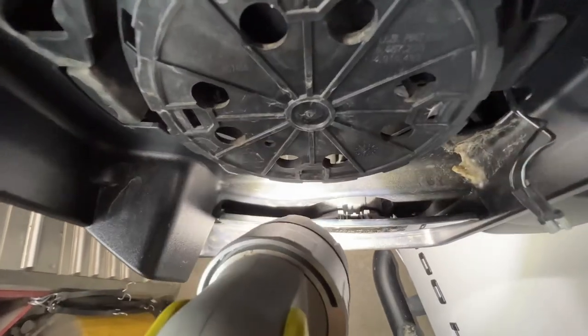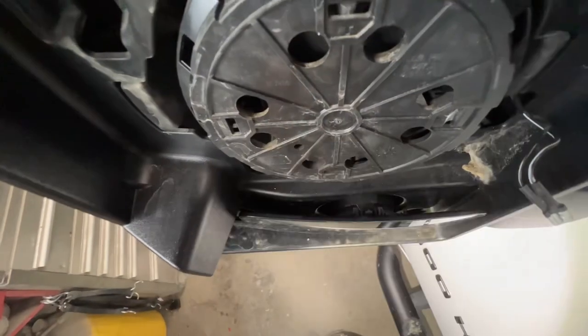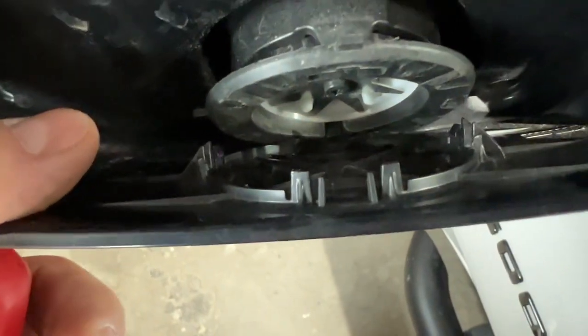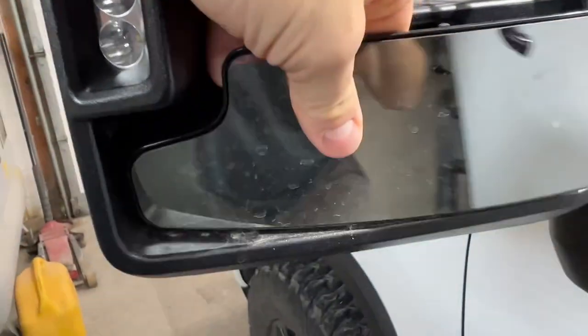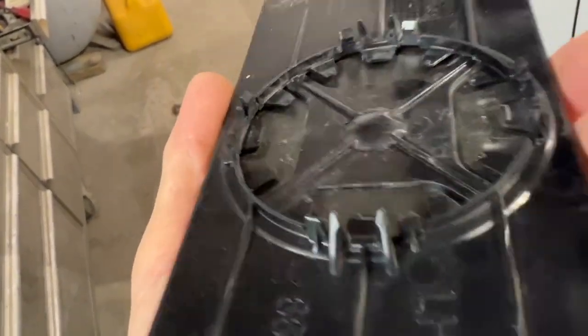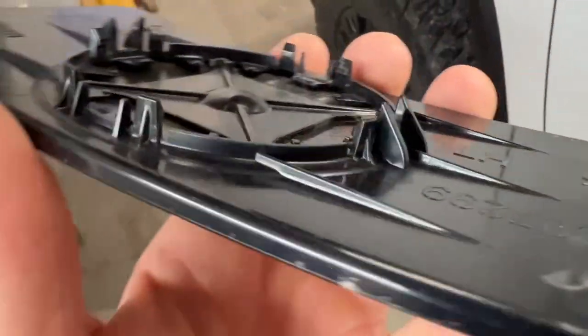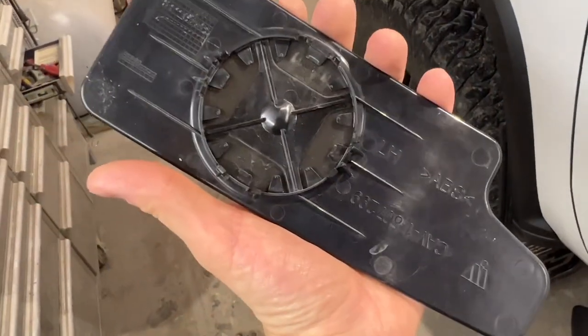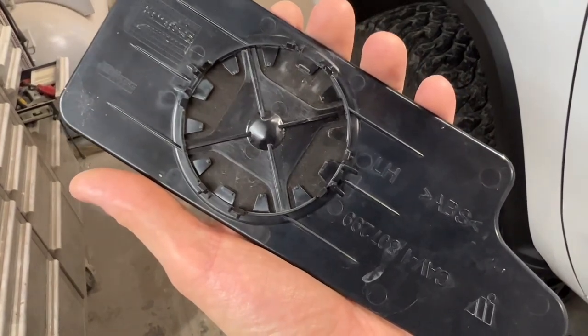This mirror housing is pretty easy — you can see tabs right there, and there are going to be four sets of those all the way around. I'll pop this out and show you what it looks like on the back. I got the side ones out, then the top ones, and did the other side. It's still snapped in but it un-pops really easy. Here's a close-up of the tabs — the taller ones are not the tabs; the shorter ones on the side are, and you can see how they kind of hook around.